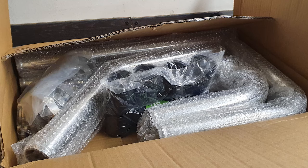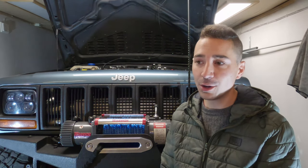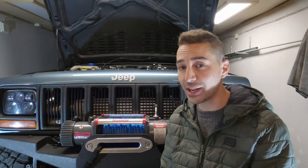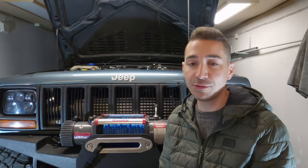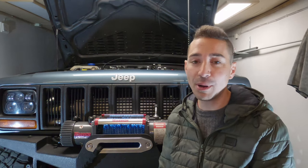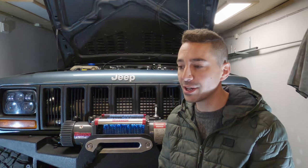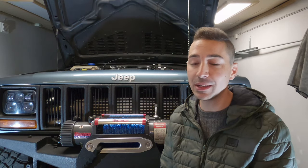And you can buy an aluminium intercooler piping kit with couplings, which I will add isn't the best thing you can do, because the couplings are always a potential area for loss of pressure and failure. But if you're an amateur like me and you can't afford to get someone to TIG weld some stainless thing up for you or build something out of aluminium, you can put in one of those kits and you will see performance gains. It will also eliminate potential failures on the road, punctures and such, and deterioration of the piping. It will mean that pressure goes straight through those pipes and doesn't cause them to expand. You've essentially eliminated a potential lag point in that boost, giving you that power on demand a little bit quicker.